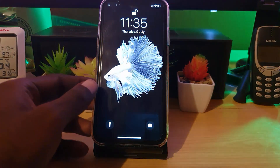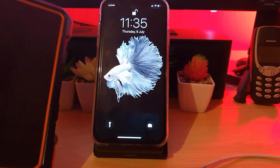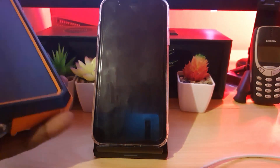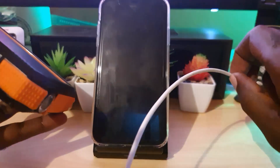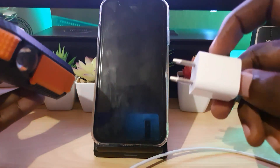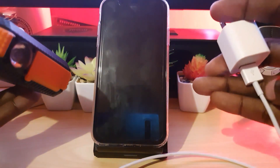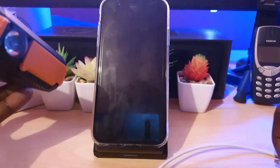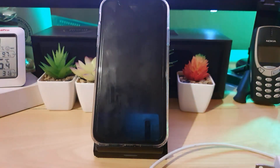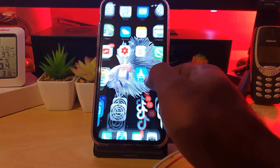You can also try bypassing your wall charger using a power bank. This one here is from XDragon, but the brand doesn't really matter. You only need your USB cable — connect it to the power bank and power can be sent through the port. So if the adapter brick itself is at fault, you can bypass it using only the USB cable and the power bank, especially if you don't have an extra adapter brick. That's another way to charge your phone while having charging issues.